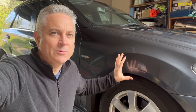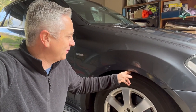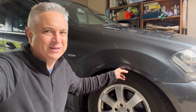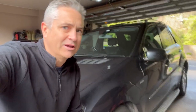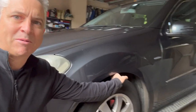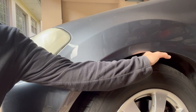I've deliberately left the vehicle sitting overnight — the engine's been switched off for a good 12 or 13 hours. The front right strut is now completely deflated; I can only fit one, maybe two fingers between the tyre and the guard. Coming around to the front left by comparison, you can see it's actually a little bit higher — I can fit pretty much four or five fingers between the front left and the guard.